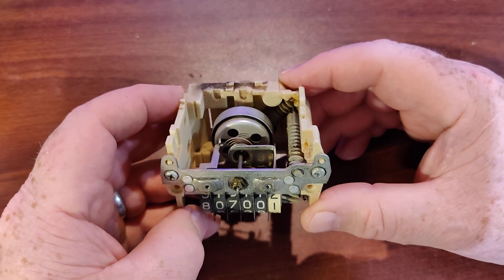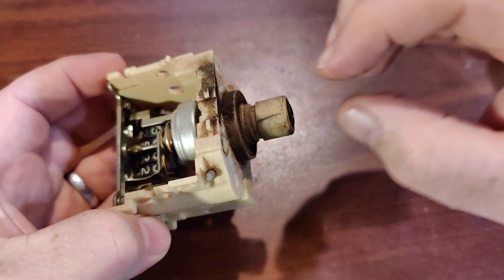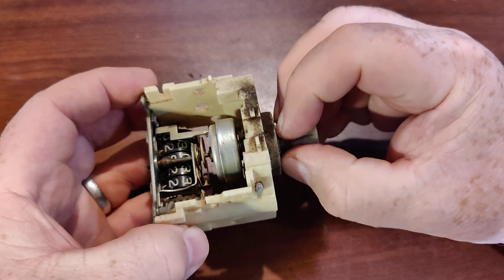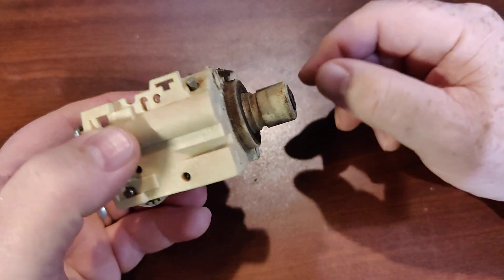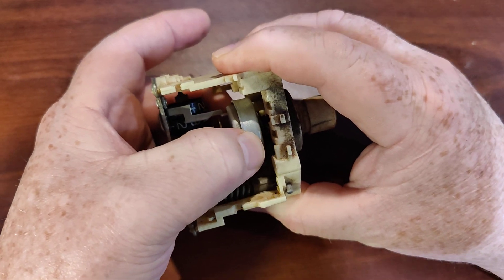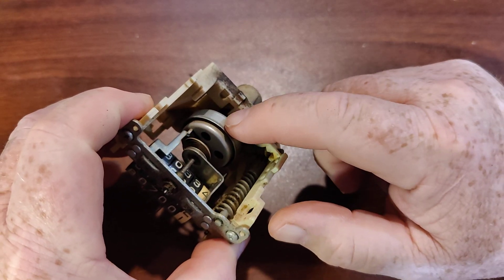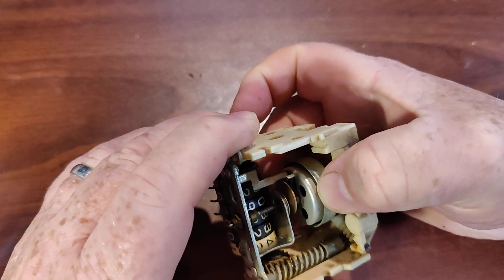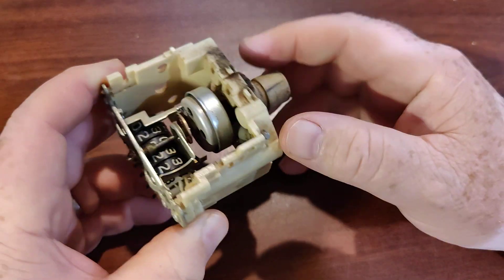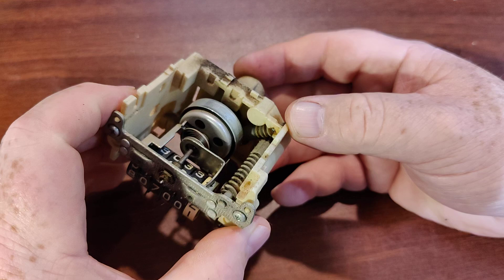I'll start out with the newest ones here. This is the newer model of speedometer body. It's plastic and has just the groove here for the clip-on speedometer cable, so it just goes on there and clips on. I call this the newer style. These typically never go bad — I've only seen maybe one or two that have gone really bad from the speedometer perspective. They stay pretty tight; I think they changed the bearing in the shaft, so they stay pretty true as long as they're not taken apart and damaged.